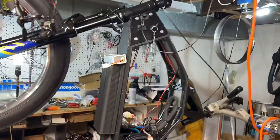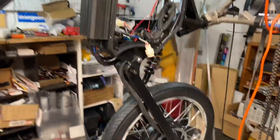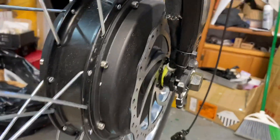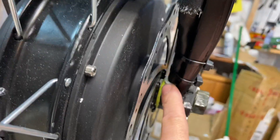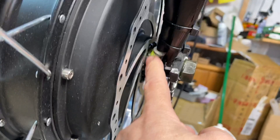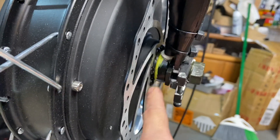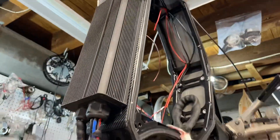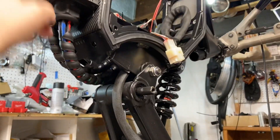Here's how we're wiring the controller on the vector frame — a lot of people ask me how I'm doing it. Make sure your motor wire isn't hitting your bolts. You can use a washer, or if you don't have a washer you can use a zip tie. Make sure your wires are not touching. It goes up inside the frame here. I put my controller down so water doesn't enter when you're riding — it goes up in there.